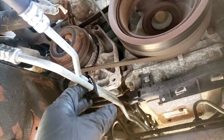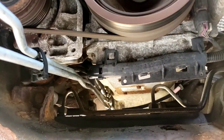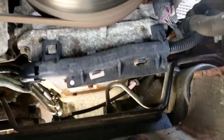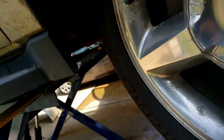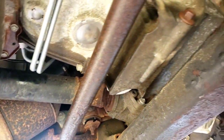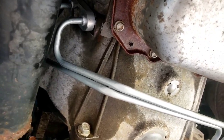As for that clip where it rotted, I had to put it back because this is such a long length that it rattles and they will hit each other. So I cleaned it up and put it back together. There's a factory clip back there that separated top and bottom. Make sure you didn't cut any wires, didn't mess up anything. Don't forget to connect the battery otherwise it won't run. Two lines, they're not rubbing each other. Up to the top, that's where it bolts to the transmission. That is all good. And we are running — running fine.